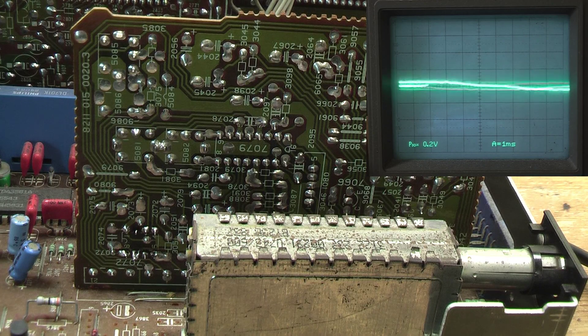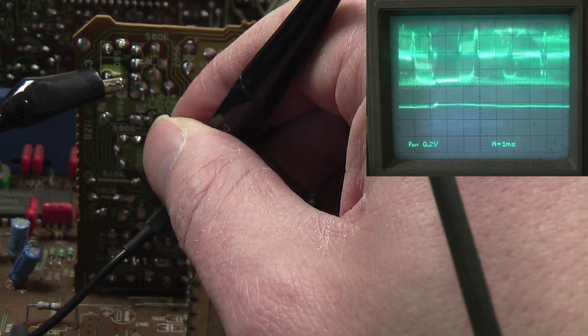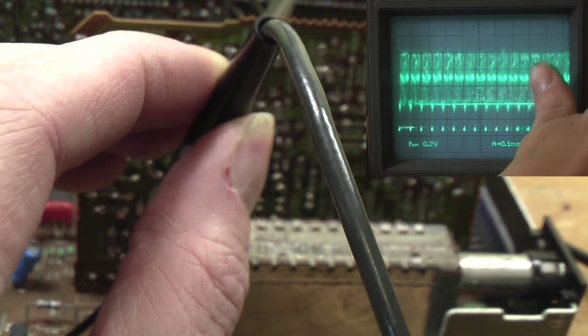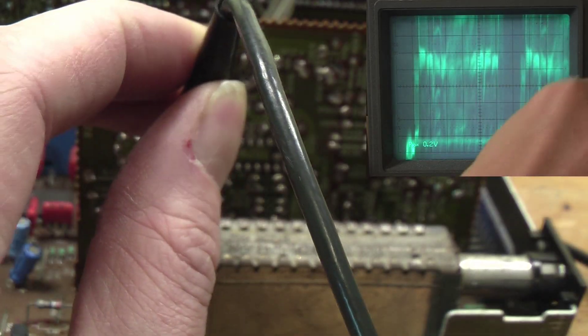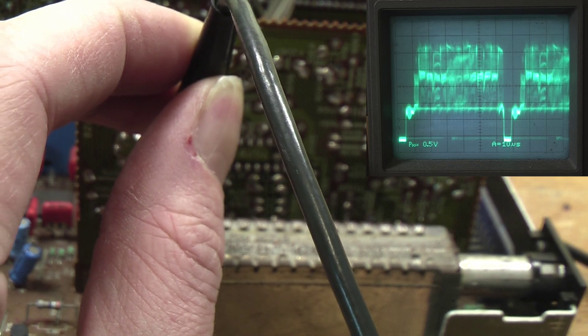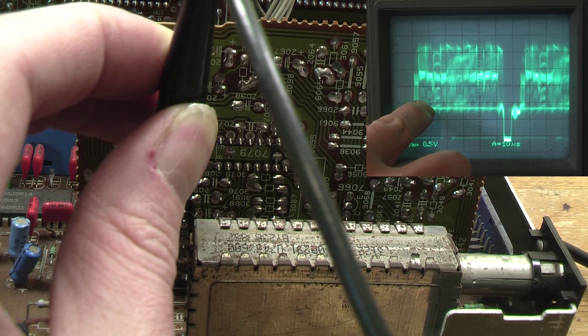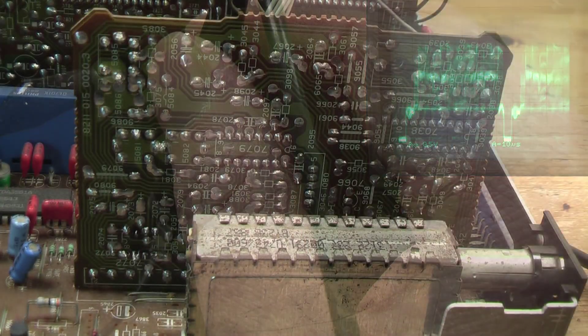So that's the TV working again. Fortunately the chips they've used are off-the-shelf parts that are still available. We'll just have a quick look at how the signal that comes out of pin 5 of the chip is meant to look. This is pin 4, and that's pin 5. It's amplified, but no surprises really - just a video signal. What I'm going to do now is just neaten up that soldering a bit with a different tip, and then put the TV back together, and that's that done.